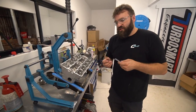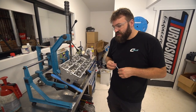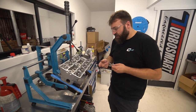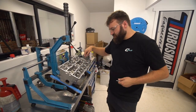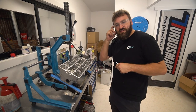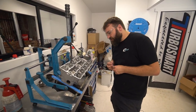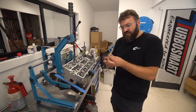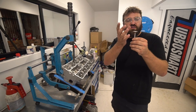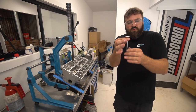So if there's ever an issue when someone calls me up and says, I have a tight cylinder, or tight valve rather, I go, what's the clearance? They pull the cam cover off, check it, measure it, and I get them to write it down the same as this in inches. Then they call me back and say, I've sent you the photo. I look at it and go, okay, we've got a problem with that valve. Something's happening. The seat is sinking. The valve is starting to cup, where if this is the valve face, it starts to buckle under the valve spring pressure pulling on it.